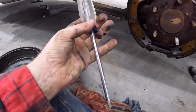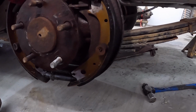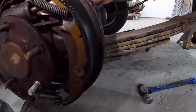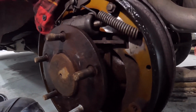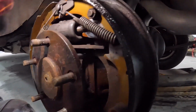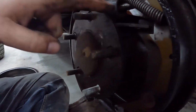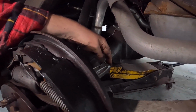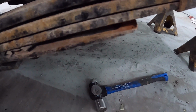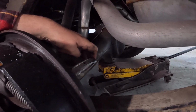Now what we're gonna do, where I put it, you want your Craftsman screwdriver. We're gonna take this Craftsman screwdriver, can I get it through without getting my hair all caught? Man, the filming is pretty good today. So anyways, we're gonna jam this Craftsman screwdriver through there, like that. It's gonna be on the axle flange, and we're gonna beat the snot out of this end with that there hammer, and it may turn out to be a bigger hammer to get the success we want and pop it out.